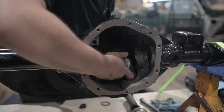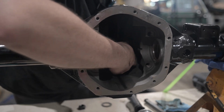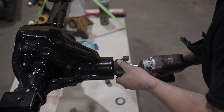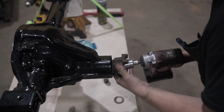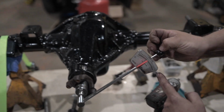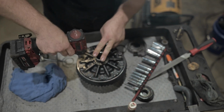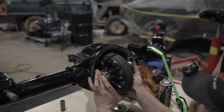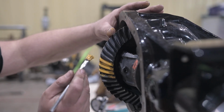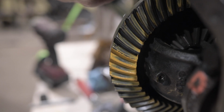If you're going to put bigger tires on any Bronco, I would recommend re-gearing the axles. Most Broncos come from the factory with 3.50 gearing and those small radial tires. Once you add larger tires, those 3.50 gears will make it feel like you've lost a ton of power in your engine. But in reality, you just added too big of tires for your gears.